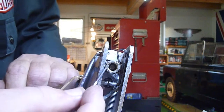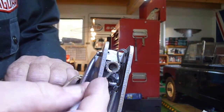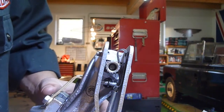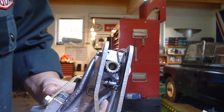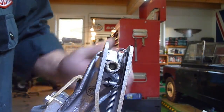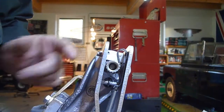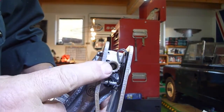So if you watch this, this is a new adjusting nut. And if you see now when I operate it, you'll see it actually catch and adjust. Basically every time you lift the hand brake, if the pads are worn, this is what should happen. And obviously if they're not worn, there will be no movement there.